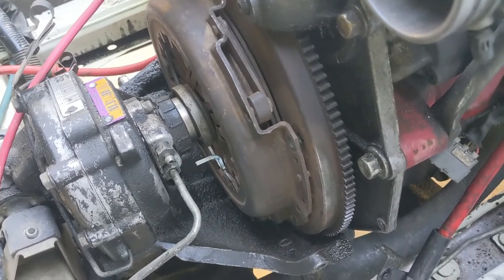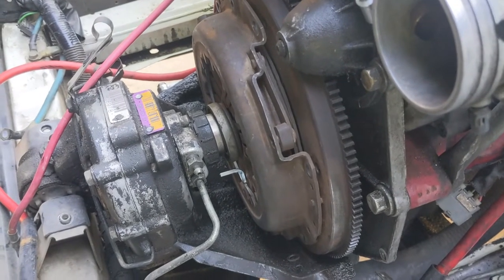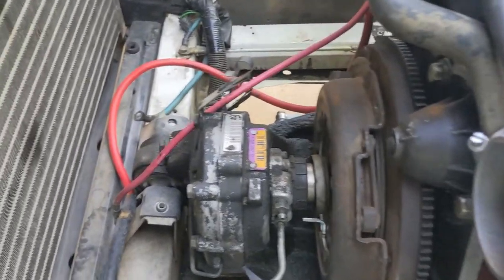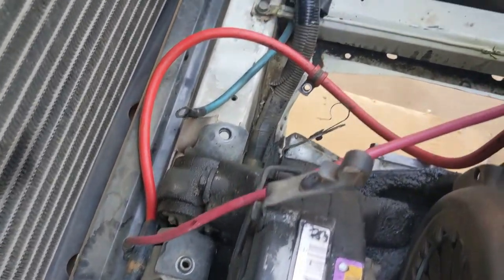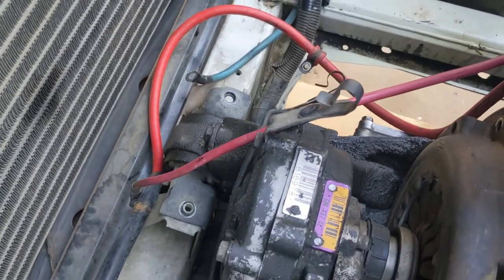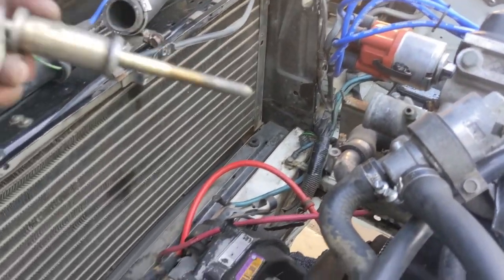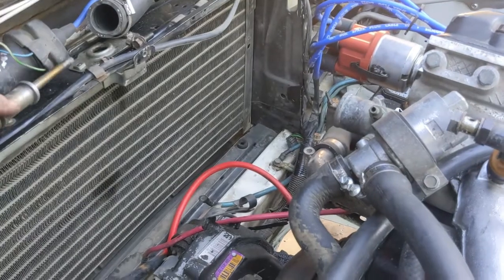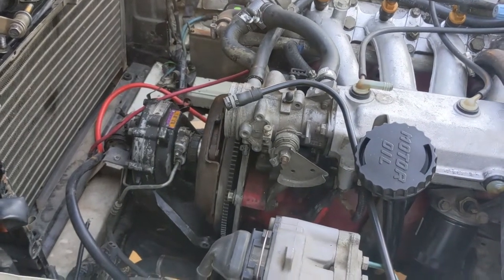Actually, I'm going to revise my opinion — I'm probably not going to change the slave cylinder. So I'm going to go ahead and dismantle this right now and leave the slave cylinder with the car. That way I don't have to worry about bleeding it when I put it all back together. In the interim, I've gone ahead and removed the motor mount bolts — the two up front. They're asymmetrical because whoever owned this car broke that bolt or motor mount at some point, and used a bolt and nut instead. It's fine, just annoying. I've got those two bolts out, and also removed the three bolts on the passenger side.